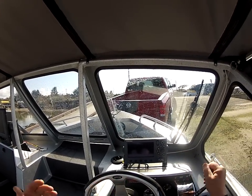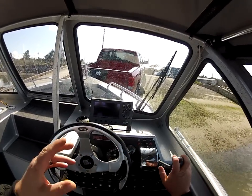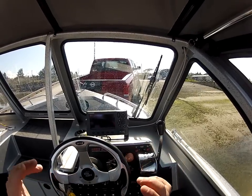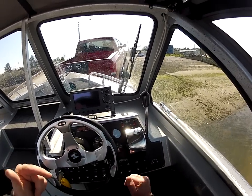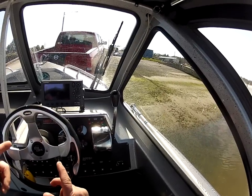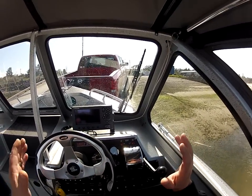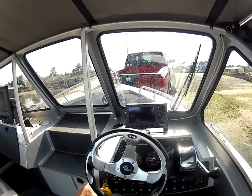You're done. Put her back in here. That's another thing with the jet — if you give it gas like this, you never want to shut the motor off or you'll ingest water. So whenever you're loading it on the trailer, remember to bring this back and let it idle down to about 950 RPM, then you can shut it off.